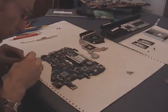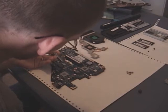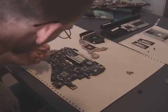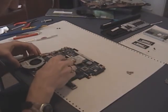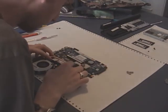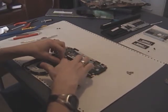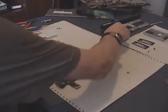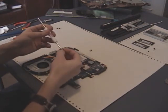We need to apply some new thermal compound to the top of this CPU. I'm using Arctic Silver 5 — it's a pretty popular compound, but go ahead and use a different one if you prefer. These mobile processors have quite a small area, so you just need a small amount — just a nice little dot of compound. Once that's on there, reattach the heat sink assembly. Plug in the fan connector first, then lower the heat sink straight down and press it onto those other two modules it's covering. Put the screws back in, get all four started, and tighten them a little bit at a time for even distribution across the processor.